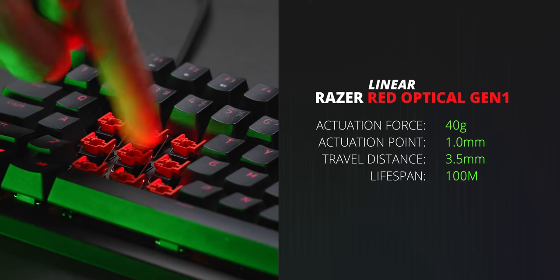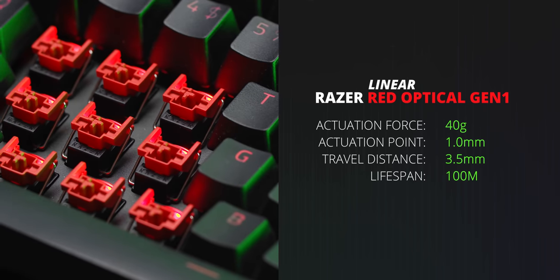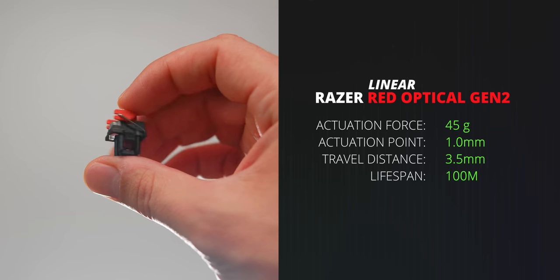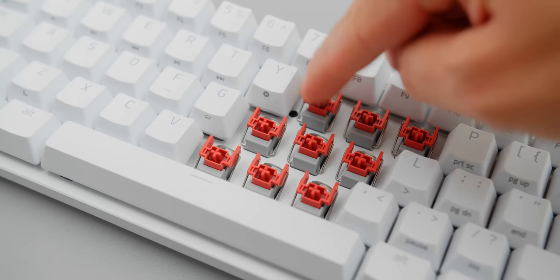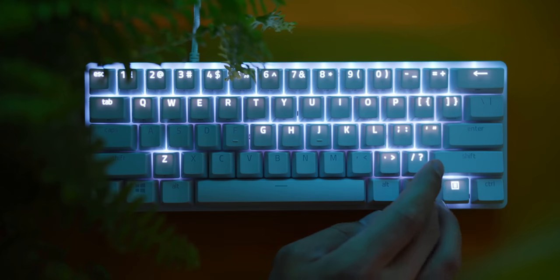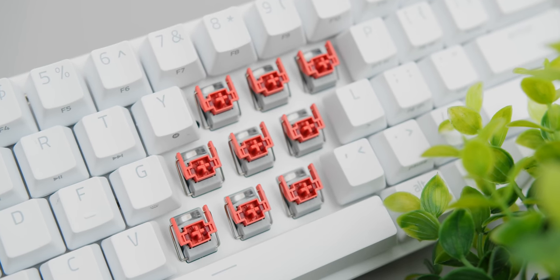Then we get into the red optical linear switches from Razer — one of my favorite linear switches. The Gen 1s actuate at 40 grams with a really fast actuation point of 1 millimeter and total travel distance of 3.5 millimeters. Gen 2 switches increased the actuation force to 45 grams based on community feedback, with the same 3.5 millimeter total travel. With the Gen 1 Huntsman TE, you really had to train your fingers not to accidentally depress the key — at 40 grams and 1 millimeter actuation point, it was incredibly light. With Gen 2, they fixed that weight so you actually have to apply a little force. They also added silicon dampeners to each switch and lubing, giving a much smoother and more pleasant travel across the entire range.